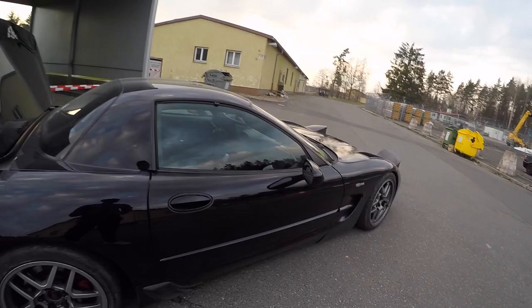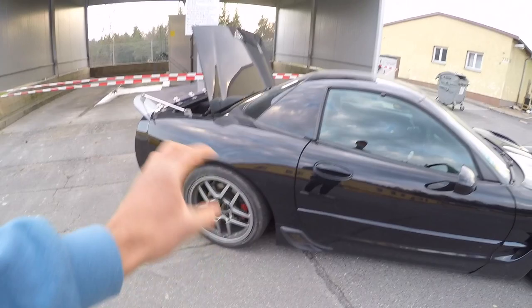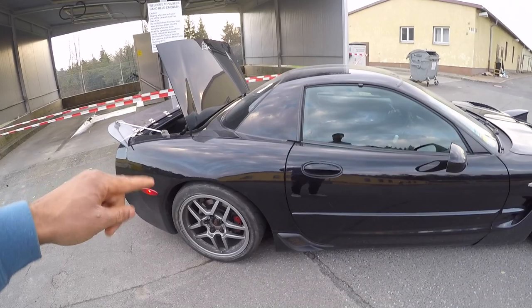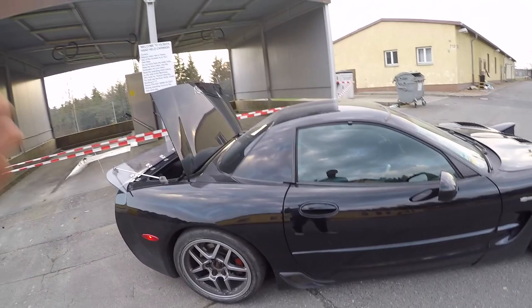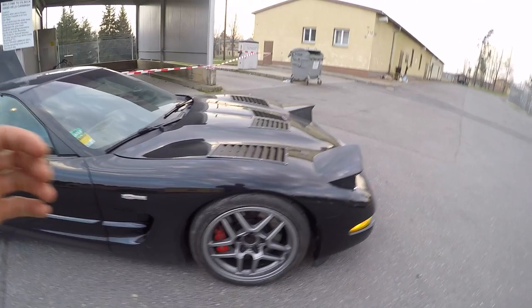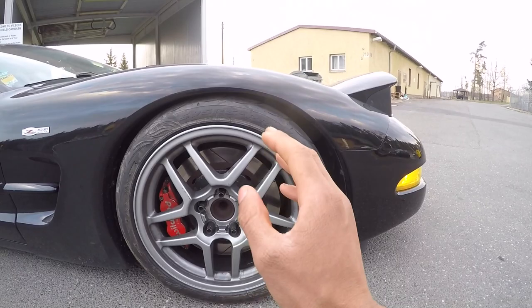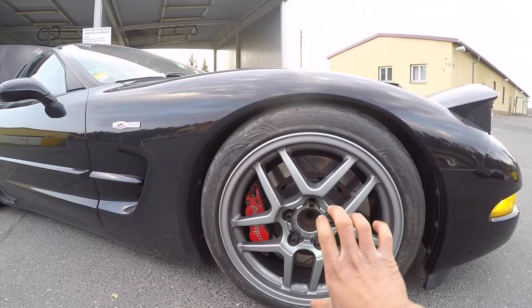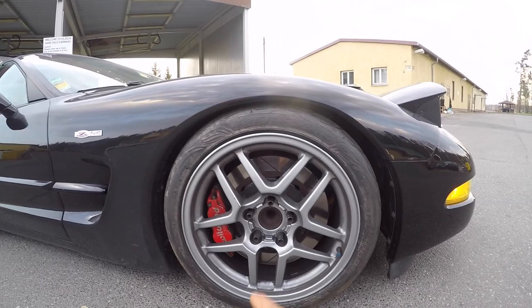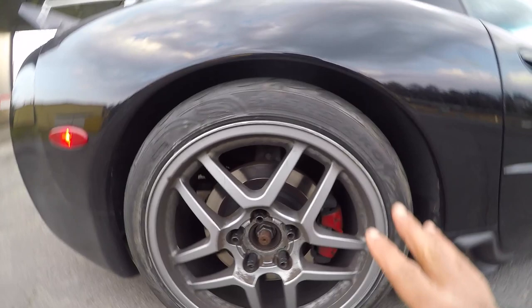Moving on to wheels, tires, and brakes — I'm running C5 Z06 rear wheels all around on a square setup: 18x10.5 all around. I'm running Federal 595 RS Pro tires in 275/35/18, though they actually measure closer to a 285 or 295 — Federal just measures their tires differently. I have Muteki black tuner-style steel lug nuts — not aluminum, because aluminum lug nuts strip out and you can lose a wheel. Hiding behind the wheel is a 14-inch Wilwood big brake kit, a six-piston setup. Front pads are Carbotech XP10s, rear pads are Carbotech XP8s, with the stock rear braking setup remaining.